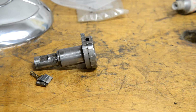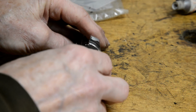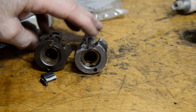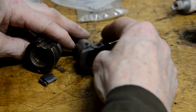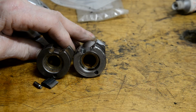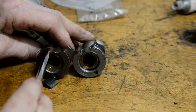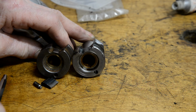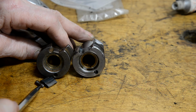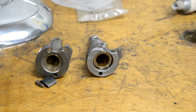All right, we're going back over to the timing side to get this gearbox finished, because the new one of those has arrived. Now let me turn these round. I don't know whether you'll be able to see this. You see how worn the shape of that is, whereas that is actually 1/4 inch. That's perfect. And the same with these parts, that was really worn. So I've got new ones. Let me put this together and then we'll finish off this gearbox.